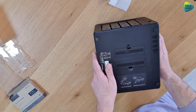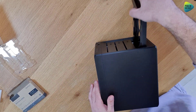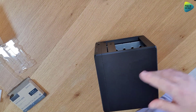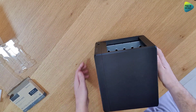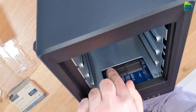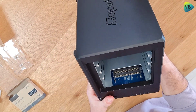For the next part, we are going to install our RAM. For this process I advise you to remove all the drive bays just to give yourself better working space, because the slots are located on the side of the NAS. The RAM slots are right here — as you can see there are two of them, so we'll use two 16-gig modules for a total of 32 gigs.